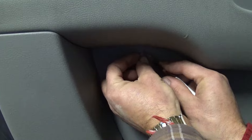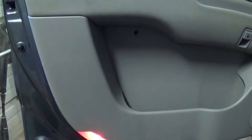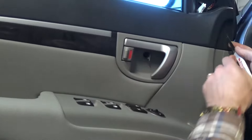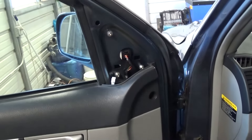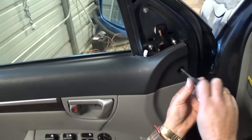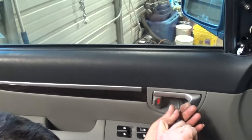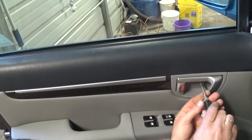Next, right here there is one little cap that we will need to remove with a small knife or a little needle, because there is a screw there. Also there is another cap where the door handle is. You just open this one and there is one more cap right there. Now we need to remove with a Phillips screwdriver this screw right here. Careful not to lose them. And then that screw in the door handle, again with that same Phillips screwdriver, just take it off.